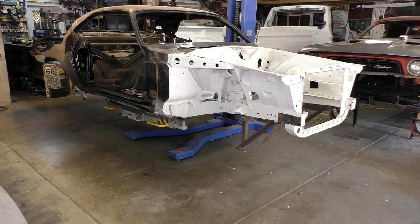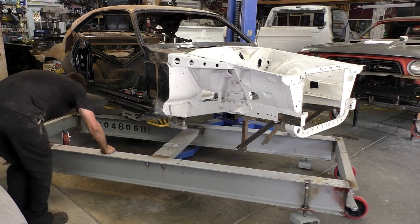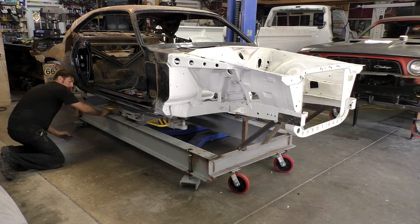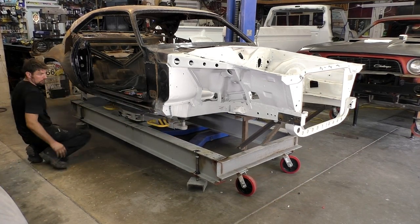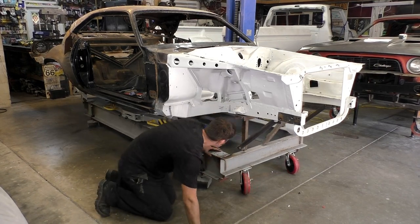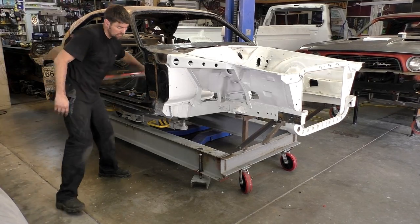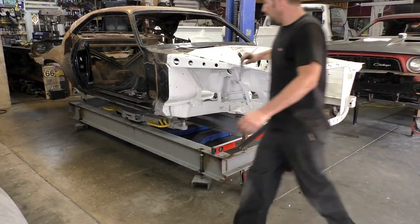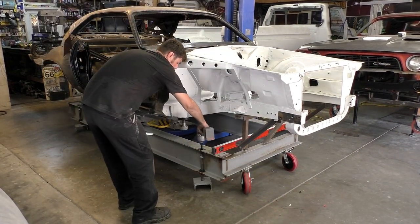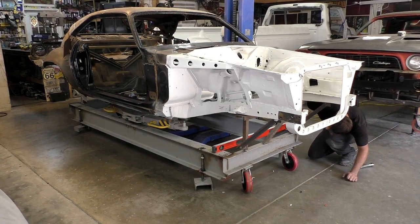This is the 74 Cuda where I mounted a frame jig today. When the car came in, it had these stands with some casters that the owner didn't care about. I asked if I could cut them up to make mounting the car to the jig easier and he said go ahead. They're not 100% straight, but I made sure I cut the same distance from the top of the frame in the front and back to make sure the car is going to hold up the same amount on all four corners.